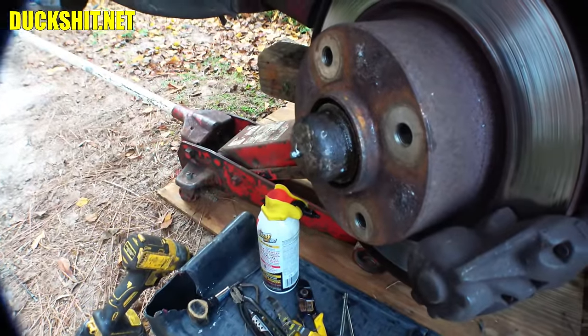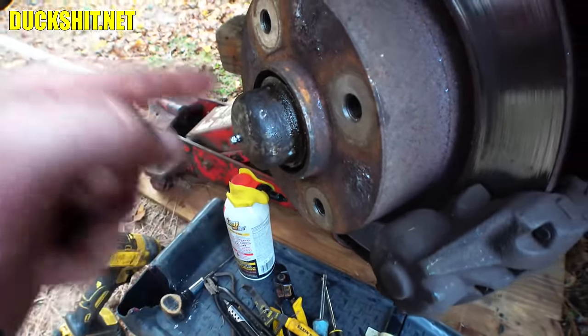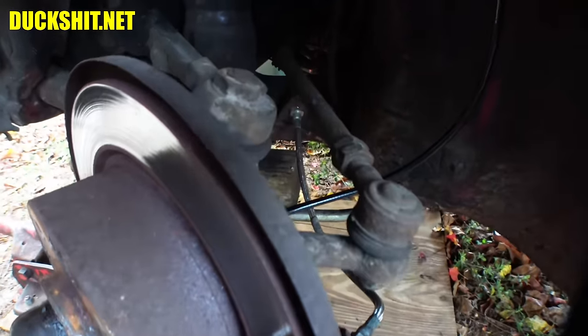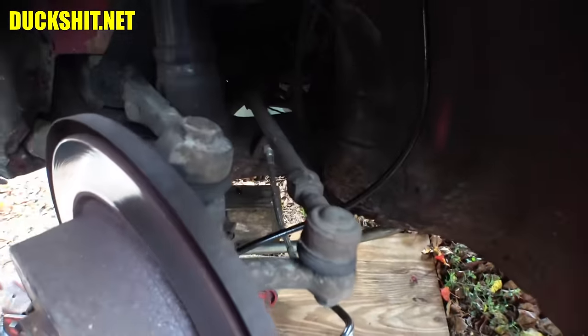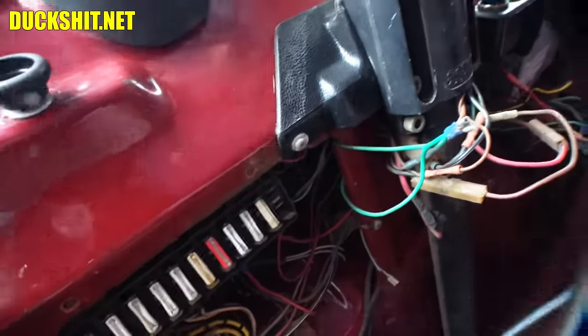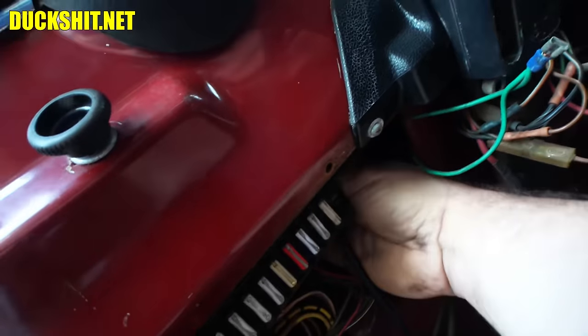As I said, I only had one hand — no tripod out here, didn't feel like going to get it. Used a little bit of bailing wire. Got the speedometer cable on there, and I put the bearing cap back on. So this wheel is actually just about ready to go back on. This cable up in here can now be fed back into the cabin. Make sure we have adequate slack, which looks good — and it's actually clearing everything, not near any moving parts. By the way, the previous cable was routed over the tie rod instead of around it like it's supposed to be. So somebody did something that was not right to begin with. Let's go ahead and get the speedometer cable hooked up back on the inside.